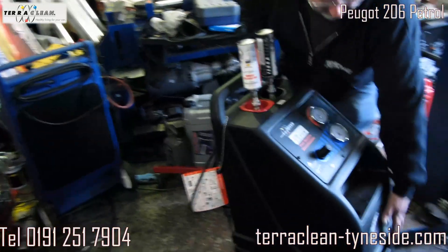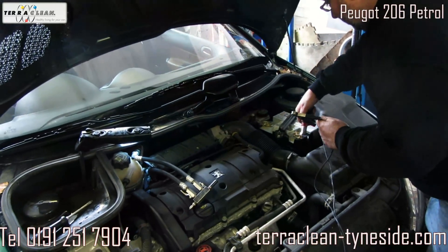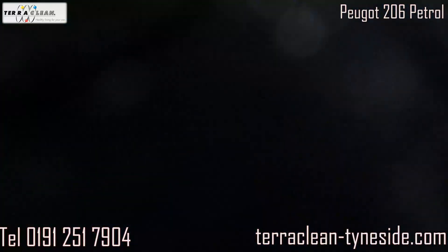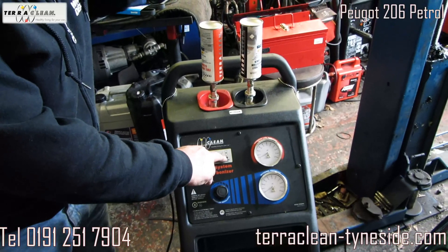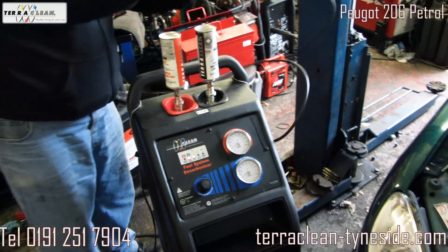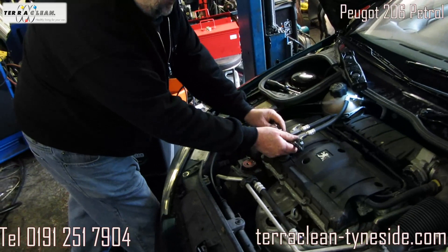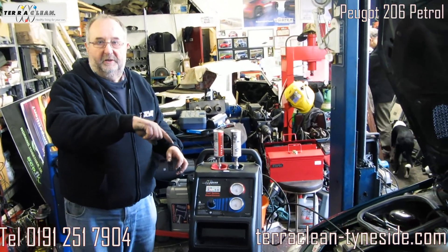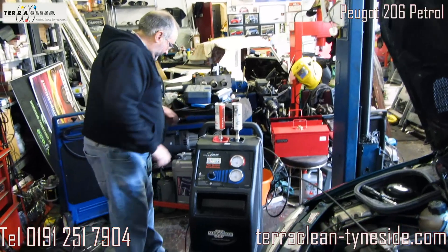Basically, you just move the machine over and connect to your 12-volt system on your battery. This is telling you that you've connected the battery up correctly. This indicator is for the red can and this one is for the black can — it uses the red can first. You connect the fuel supply and the compressed air to here, because you've disconnected the fuel filter and the fuel pump from the system, and you're putting the pressure that the fuel pump would normally put in — putting the fuel into the rail at the same pressure as the fuel pump would have done. You do that by connecting the airline to it.